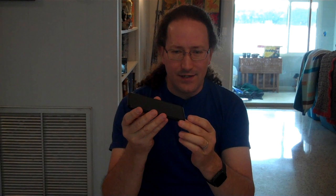So the options are either buy a new phone — the Google 6a you can get for a discount for about $260 — or replace the battery. Unfortunately in this particular phone the battery is glued in and the screen is glued in on top of it, so to replace the battery we have to unglue the screen, flip the whole back cover off, and then pull the battery out and swap it in. Overall it's about 25 steps and medium difficulty level.